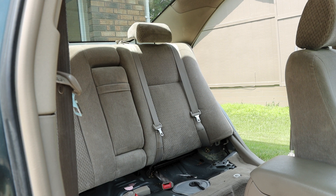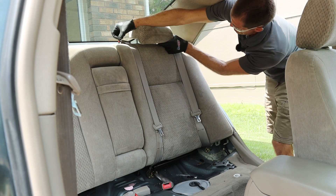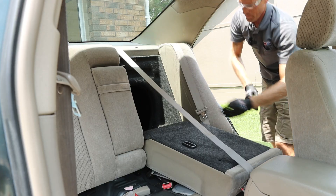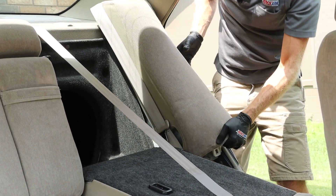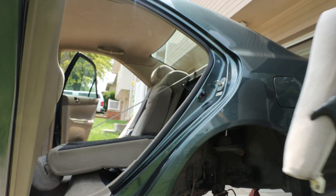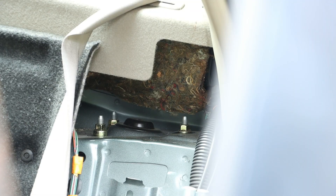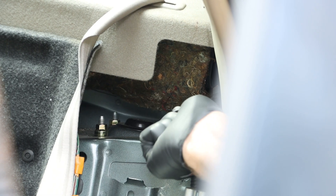After that, we want to locate the seat release knob, which is just left of the headrest — we can lift that up. Work that seat down, then take the bottom corner of the cushion and lift it upward. Taking a look underneath the insulation, we can see three bolts connecting the top portion of our strut, and using a 12 millimeter wrench we can loosen these up.